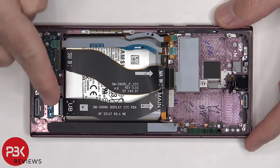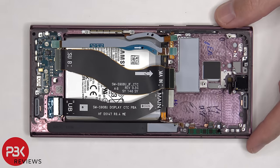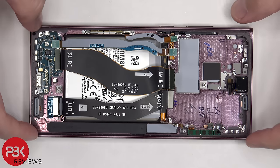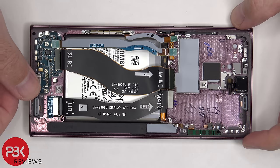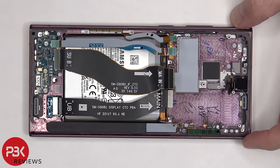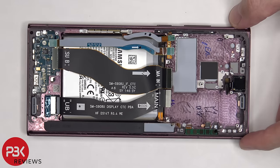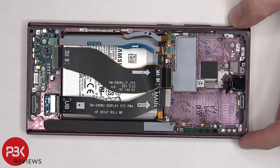There's an extension flex cable which connects the screen to the main board. So for screen replacements you should be able to pry off the screen from the front of the phone without having to disassemble the rest of the phone. However it might be a little more difficult trying to align the screen with the flex cable to reconnect it when applying your new screen, since you can't really extend this flex cable out too much. So you'd have to perfectly align the screen to the frame and seat it down and push down on the bottom to get the flex cable to attach to the connector. In some cases it might be easier to take the back plate off and remove the bottom speaker assembly so you can make sure the flex cable is connected properly.